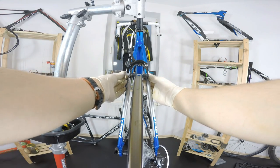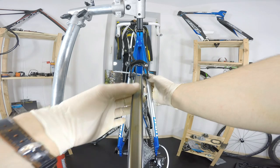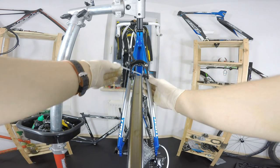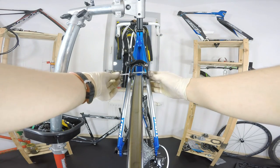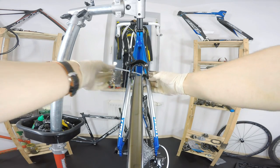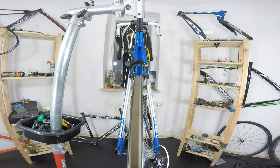I would assemble it just like this, just above the rim, so that you will see radially whether the rim is true or out of true. Another one just below it. I would cut the end of it so that you can also adjust it so that you will see whether it touches the rim or not. So a zip tie can also be a helpful tool.